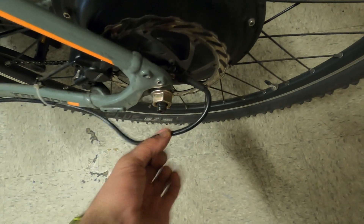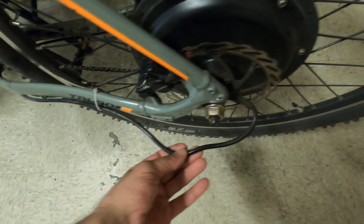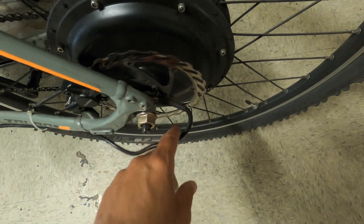Once the bike came in I installed the kit and went out for a ride. I've installed a lot of kits over the years, but on the inaugural ride something strange happened — I started hearing a clanking sound in the hub motor. It was brand new, so I kept testing and couldn't figure it out. I looked at some forums and found someone who said 99% of problems are wiring. Sure enough, the wires coming out of the hub were too taut. I gave them a big arc of slack and it worked fine immediately — just a little tip.